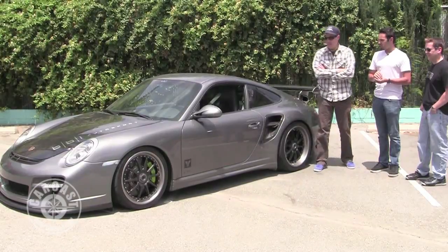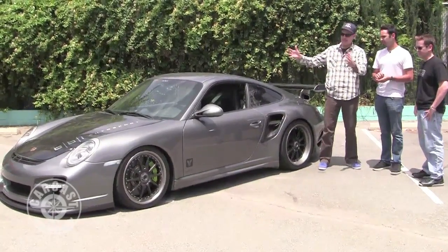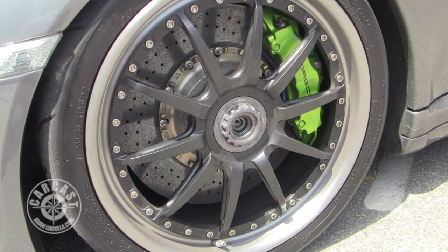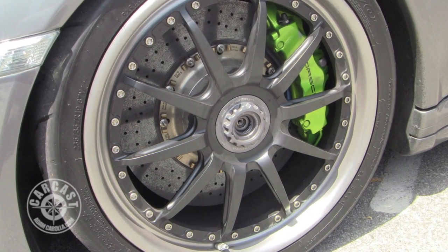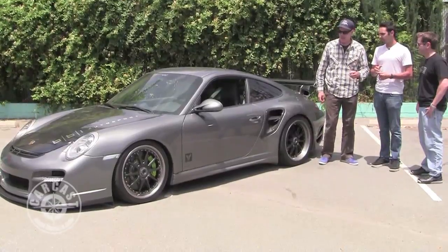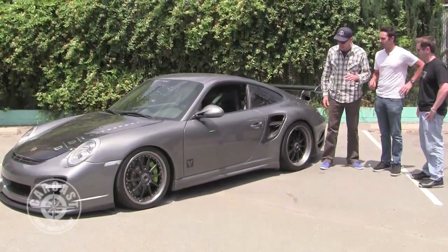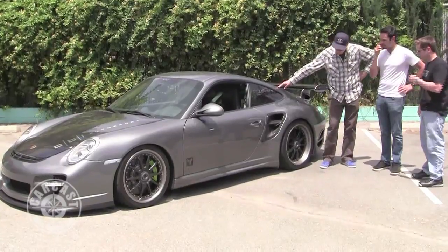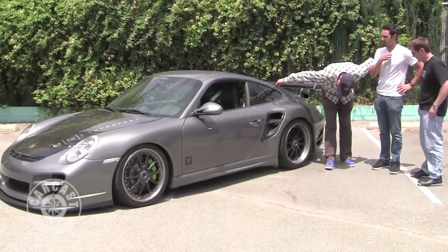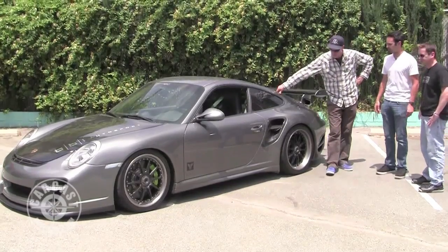Not only is there a lot of tire up there, but you can see it is filling up that fender. It's 10 millimeters out on each side — a little less than half an inch — but everything starts to add up once you do everything. It really helps on turn-in, and these things tend to understeer quite a bit on throttle, so it just keeps a little bit more front end on the car.